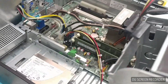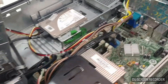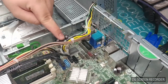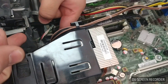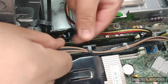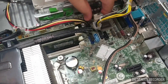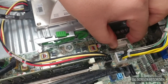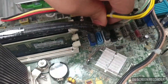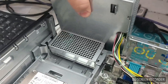You can see the cables — there are about three cables coming out of the power supply: this one, this one, and this one. We're just going to have to undo those. I'll start with the one right next to the fan, unloop it, and then undo this one — move it side to side slightly so it comes out — and finally undo this one.